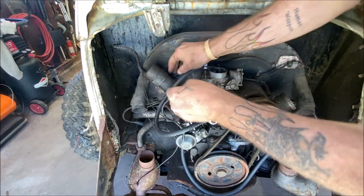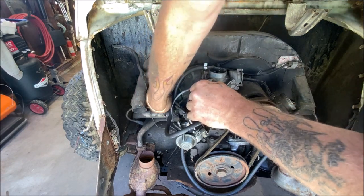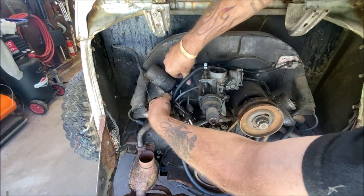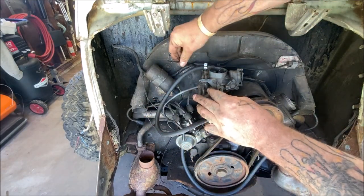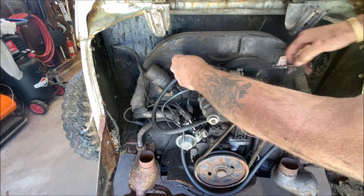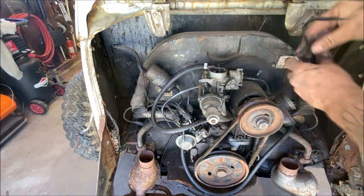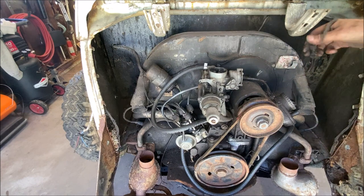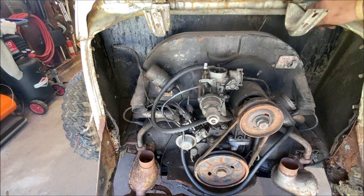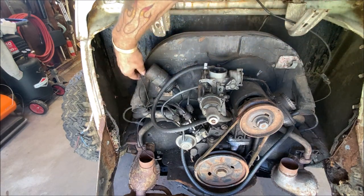And the other one is going to be your backup lights. Let me get it off the coil and I'll show you. There it is there. And it's clamped on. Comes across here. Over there. So we're going to unclip the inline fuse from there because we don't want it coming off and ripping it when we pull the engine. Okay, so there's your wiring there.